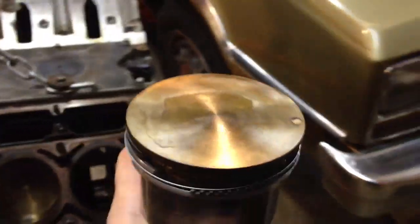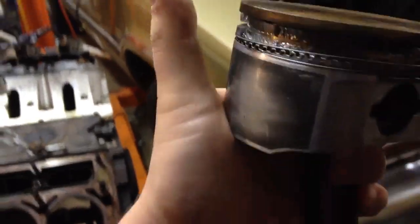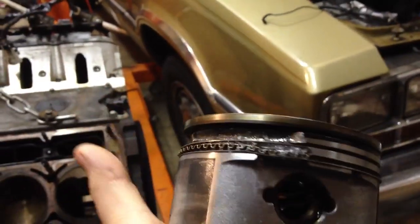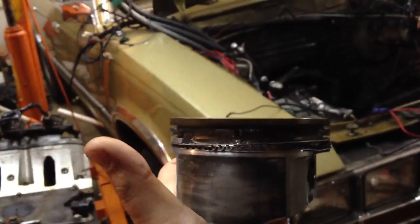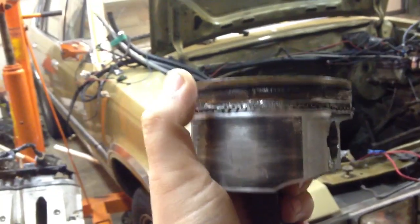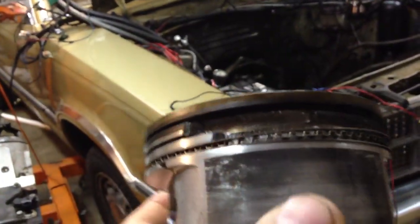What he is saying is happening is: when the piston — see, I broke all the lower, not the upper. So he's saying it's not ring butting. Because almost 90% of the time, when the ring butts, it rips the top of the ring land out. When the piston's on its way down and the ring is too tight, it rips the top right out of there. What's happening to me is I keep getting downward breakage — everything below. Even the oil control ring busted through the bottom of the piston. When this is on its way up, it's pre-igniting and it's shoving all the rings down really hard. While this is going up and the compression's knocking it down, it grabs that ring land and breaks right through these stock, fragile ring lands.